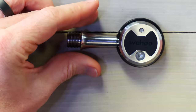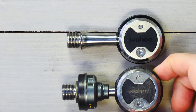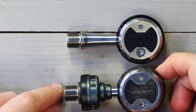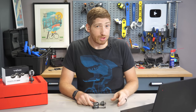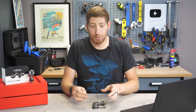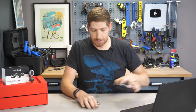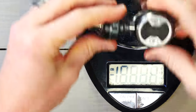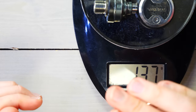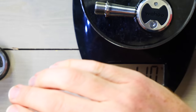These pedals are based on the Speedplay Zero pedals. Comparing them side by side, they're very similar but not exactly the same — the power meter version is one millimeter longer than the existing one, which is why when you buy the single-sided version you get that dummy pedal too, so the spindle lengths match on both sides. The weight of the pedal itself is 138 grams.